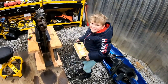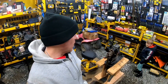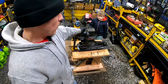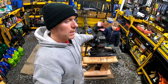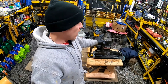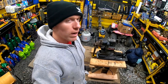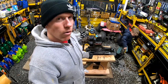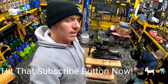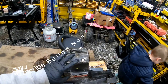Welcome back to White House Farm. This is the Mercruiser stern drive — the one we did the video on replacing a complete impeller upper and lower. We're going to open this up, take a look at the top gears, see how everything's looking in here, and then do a stern drive oil change. Hopefully everything looks good in there, and then this thing will be all set to be thrown on another boat.